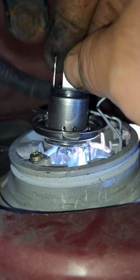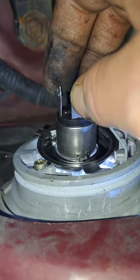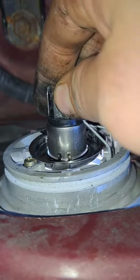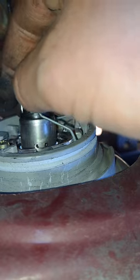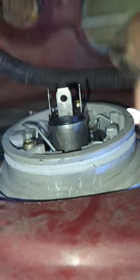Take the old bulb out. It's got the exact same three prongs on it — one down here, one right here by my thumb, and one down here by my ring finger. Once you get your old one out, seat your new bulb right back into place. Take that wire retainer clip, push it down towards the ground a little bit — push towards the front of the vehicle and up to release it, push down towards you and then down towards the bottom of the vehicle to lock it.